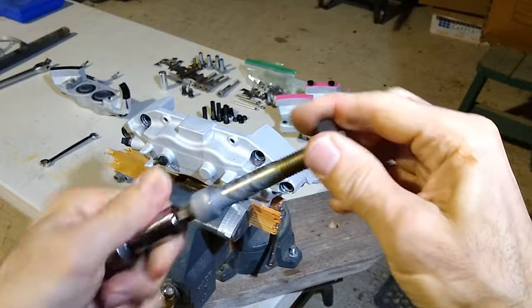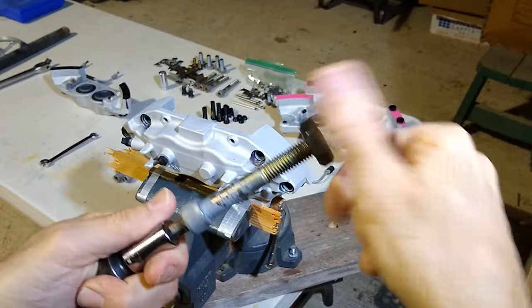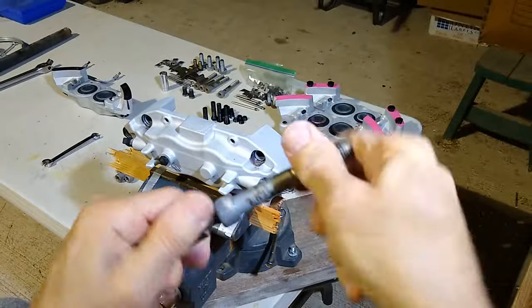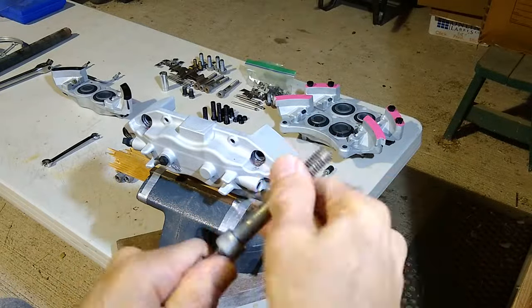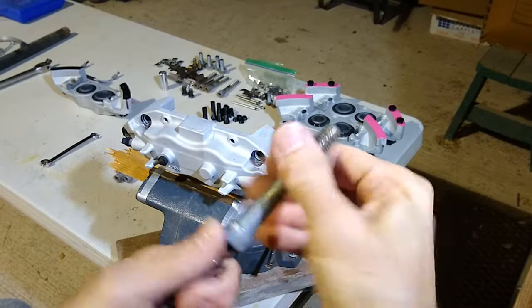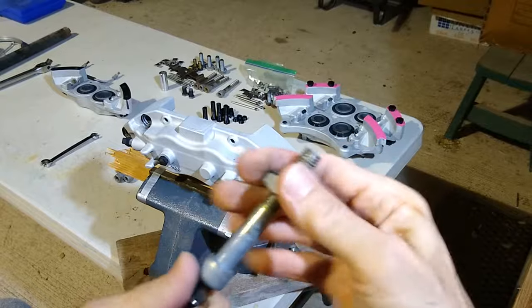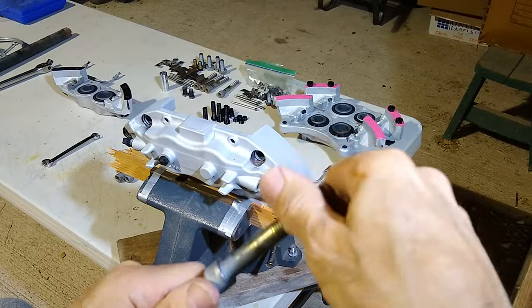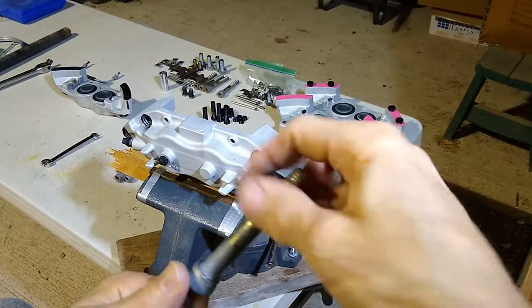It's these little steps that you take that are going to avoid problems later on. All right, so I'm going to do that for all four of the bolts. And tomorrow's going to be exciting. Tomorrow we're going to start polishing up all these pieces. I just have a little bit more touching up to do on this one with the 36 grit garnet. And then we'll load the 80 grit glass bead and start the polishing.